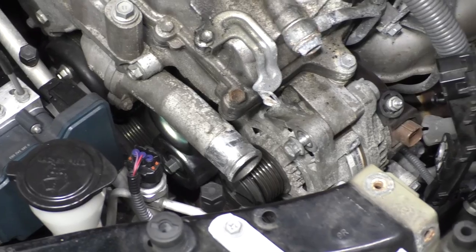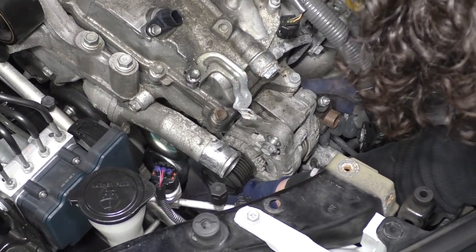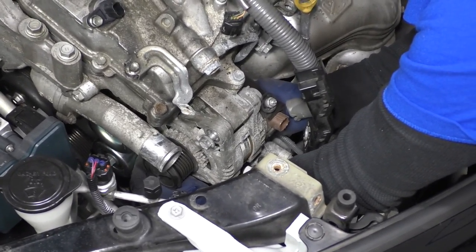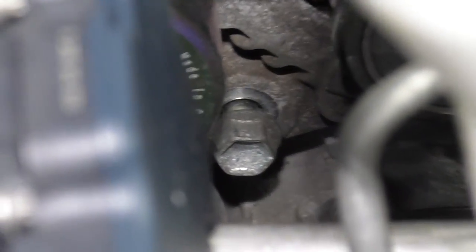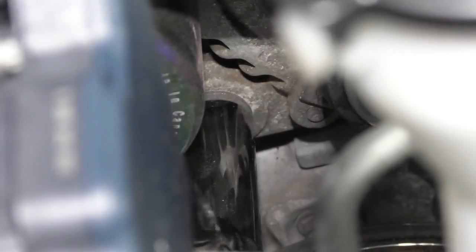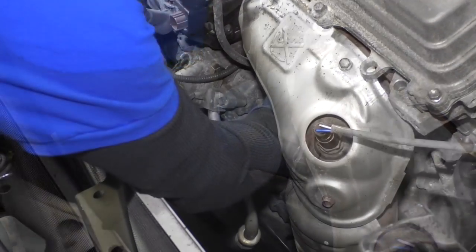Start the long bolt. Now I've got the two bottom bolts — this is the front one and this is the back one that goes to that bracket. Put the front on first — that gives a lot easier alignment for the back one, because you can barely get your hand back there. You might have to start this with a socket and an extension. Then hand tighten both as much as I can, then use my three-eighths ratchet. I'm going to put my 12 millimeter swivel on the extension back through the backside and snug up that back bolt. Just snug them up.